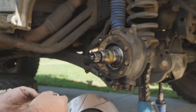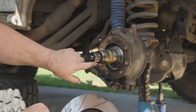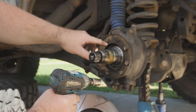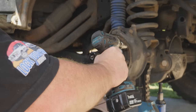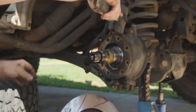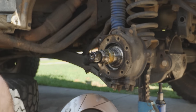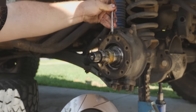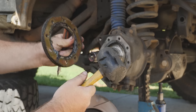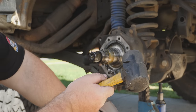The CV actually has a grease nipple — that's not a standard CV, these are aftermarket CVs — and we'll take all that apart in a minute. First thing we have to do is get this seal off. There's a series of 14mm nuts around the edge which holds the seal and the spindle onto the knuckle, so we'll take all those off. Because I don't run backing plates on the disc, I've actually got a spacer in there which we can have a look at later when it's all cleaned up.